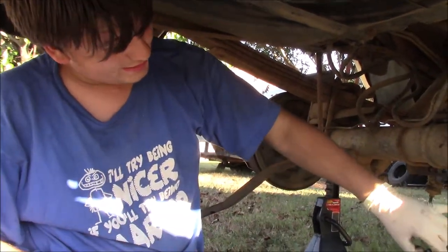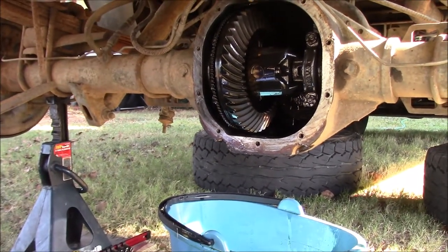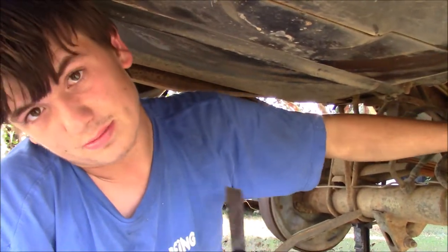If you can get a light in these holes, can you get a shot of that? And see that, if you can see it, there's crud in there. And that's all silicone. What that's going to do is change the torque rating. So whenever you torque it down, it's not right, because there's RTV in there, it's preventing you from getting the proper torque amounts.